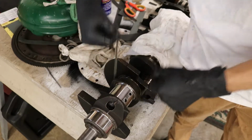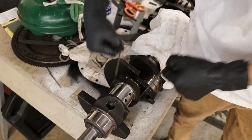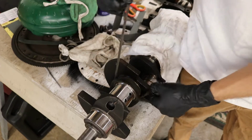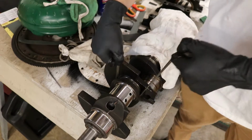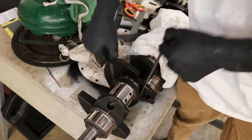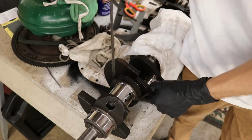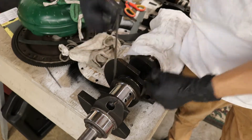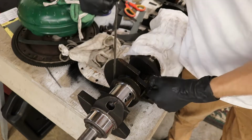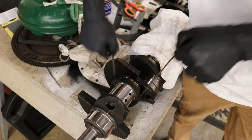You definitely want to sand more at a lower grit. So if you have problems, you want to try to get it out at a lower grit, because a higher grit just won't do it. Really, you want to get all the stuff out on your first grit. So with 400 grit, I want to get it to where the 800, 1000, and 2000 grit just polish rather than remove material, because they don't remove material at all. That was a screw up on this one. I didn't do 400 and 800 enough. So when I got up there, I didn't like the way it looked, so I ended up having to redo it.